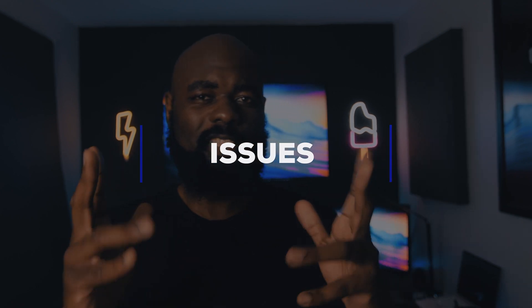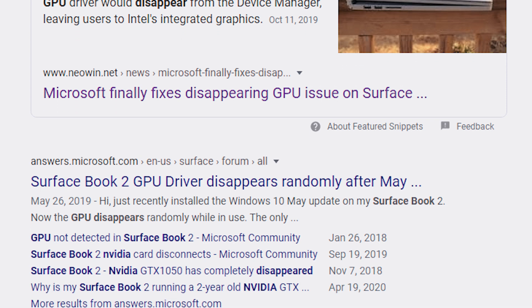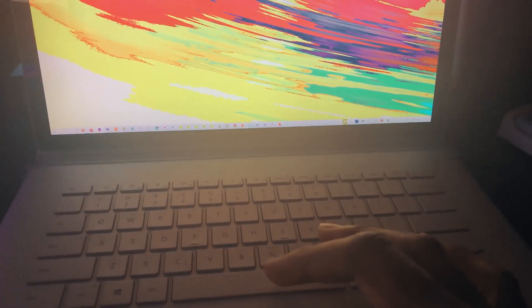Let's talk about some of the issues I ran into with the laptop. One of the main issues was the graphics card. Since my first unboxing video I noticed something was wrong — the graphics card would sometimes disappear from device settings. I did some research and apparently this has been happening since the Surface Book 2, so they didn't fix it in this version. After a while I also started getting graphical artifacts — it happened randomly one day, then twice this week — and the screen would just look all weird, like the graphics card is going bad. So I'm going to have to return the laptop.